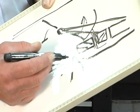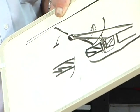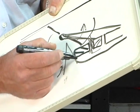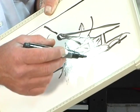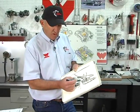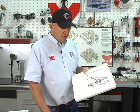So you run into a lean hole here, and it's just the opposite if the mixture screw for your lean best idle is so far in that there's just barely an opening here. The pressure buildup here, as soon as it exposes these progression holes, just dumps gangs of fuel, way too much. So in order for your progression circuits to work, your mixture screws need to be in the operating window, and that's the 3/4 to 1.5 turns out.